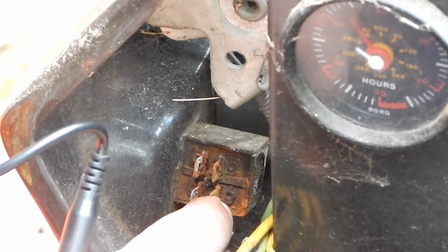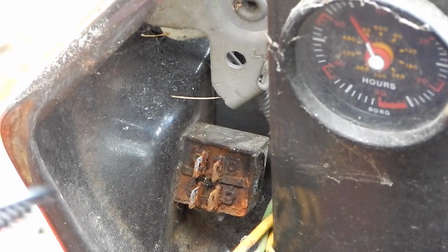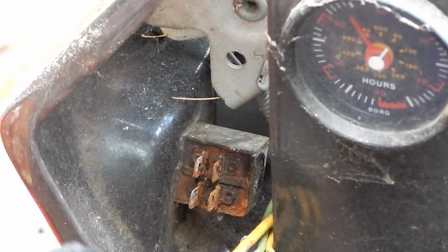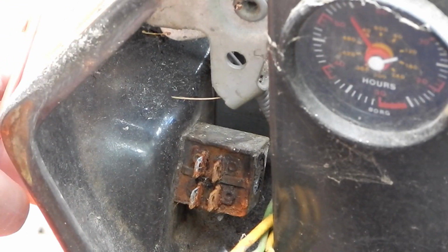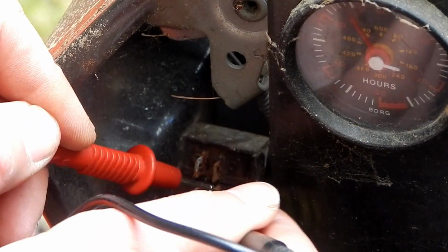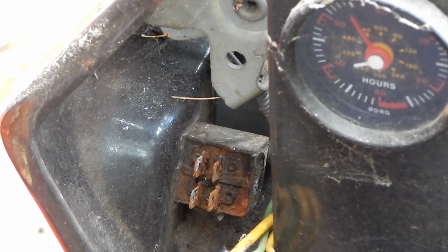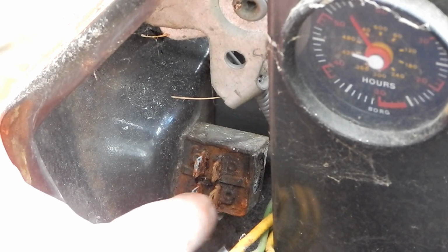This is probably a double pole switch. So I would say, let's see, this says pull for power. So if it's in, that's probably no continuity. And then if it's out, you see I'm getting nothing no matter what. Pull for front control implement power. It's only 2 positions. And the other reason I know it's not in the middle, that it wouldn't be like a 3-position switch, is because there's only 2 connections on each pole.